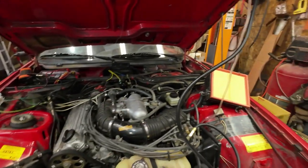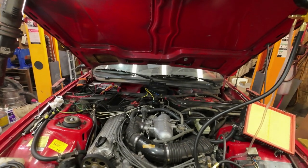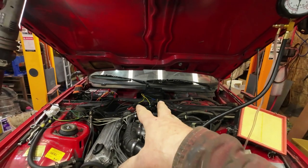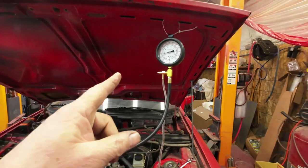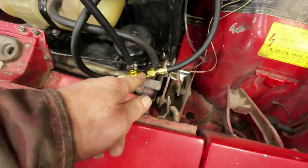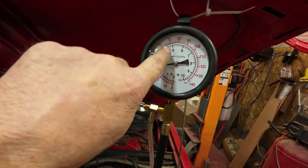When I get it out, first off, I'm going to come up with initial readings, and I'll show you what I have for initial readings, and then I'll write it down so that I remember. Then I'll take it all apart, and then I'll set it up for testing and getting it set right. Okay, so there I did that. What I did was I ran the fuel pump with this closed, so that picks up system pressure. Now it was at 4.8 right there, bar